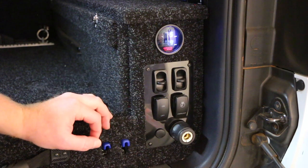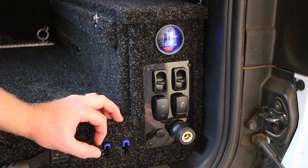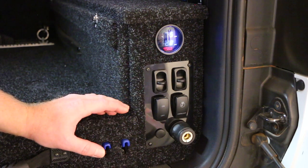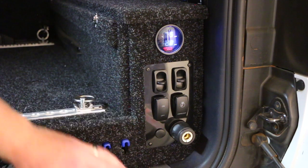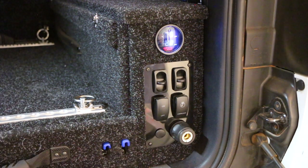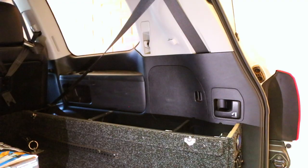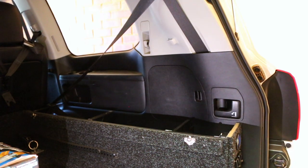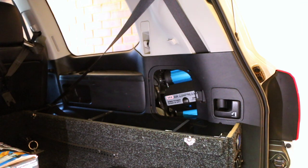This is one of my favourite modifications. Being a family that tows a van and frequently off-grid or towing off road, this gives us the ability to adjust the suspension both when hooked up to the van and when driving without it — very quickly and very easily. The standard ARB outlet at the bottom reaches all four wheels on the van as well as all four wheels on the car, so one standard ARB hose kit pumps up all eight tyres in our setup. One of the real handy parts about the 200 Series is the space behind the plastics in the rear cargo area — ARB have managed to fit an ARB twin air compressor inside those plastics, linked up to a four-litre air tank.